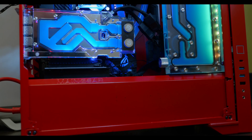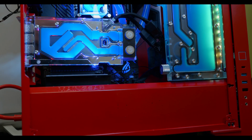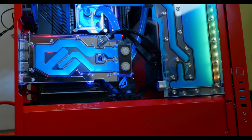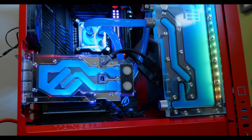The test system has a 240mm radiator on top — a very thin 20mm radiator — and a Corsair 240mm radiator on the front, which is a little bit thicker. I threw the 3080 in there with a water-cooled block, and right away temperatures definitely improved. With one GPU and double 240mm radiators, the GPU core was generally staying in the high 40s to maybe low 50s Celsius.